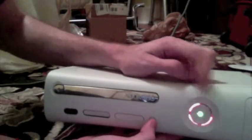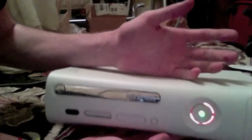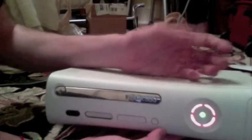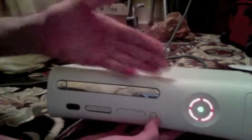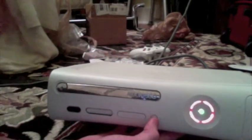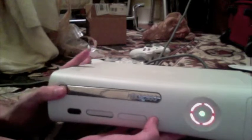When the lights change, that's when you get your first error code digit. It's normally going to be zero, and zero is four blinking lights. Press it again to get the next digit — still zero. So far our error code is 00. It's going to be four digits, so you're going to have to do this two more times.